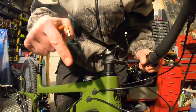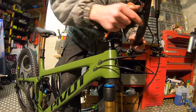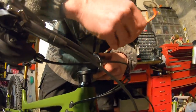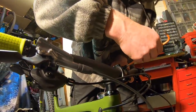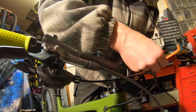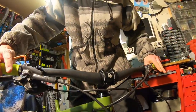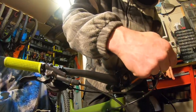Pivot's own headset — but you can run external or internal lower headset bearing depending on how you want the geometry to sit. And then you've got Pivot's own carbon bar: nice, flat, low-rise, looks to be a good shape. Bar width varies by size — starting at 760, running through 780 for most sizes including this large, then topping out at 800 on the extra large.